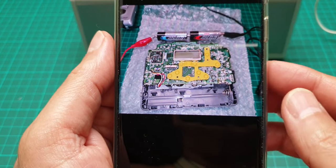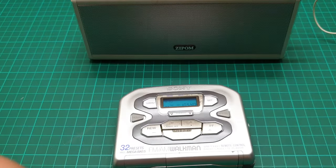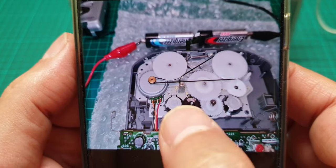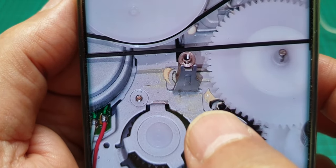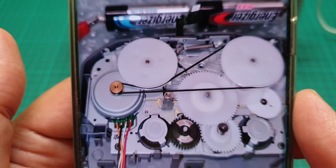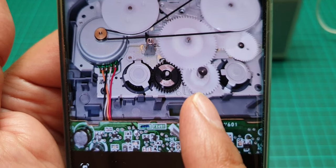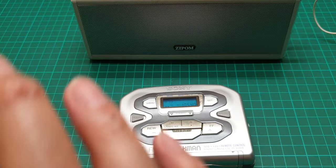It was chewing the tape aggressively and damaged some of my tapes, but now everything is fixed after washing and cleaning the transport system and putting it back together. This image shows before cleaning — you can see the color of the grease; it was dried and not really greasy anymore, some of it was really bad. Then I greased it up, and this is how you put a belt on. It has this clutch part that comes up and goes down to engage the gears.